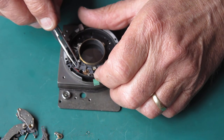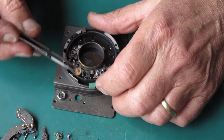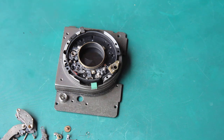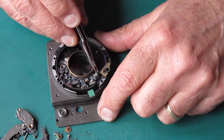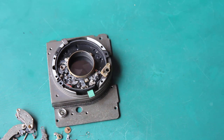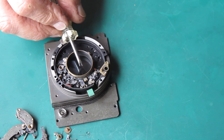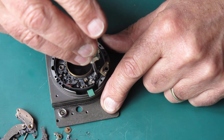This should just lift off — there we go. Here's our pallet wheel, and some tricky stuff. This screw that holds this has got a post in the middle so it's split. You could get at that with a pair of sharp tweezers perhaps, but I've got a screwdriver made to do that job — in fact I've got a couple of them. It's a simple screwdriver with a slot cut up the middle of the blade to clear that post.